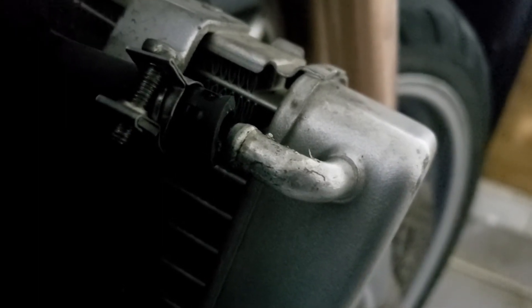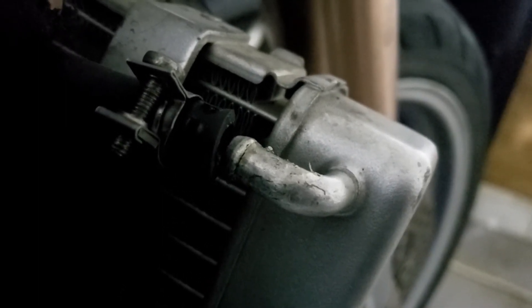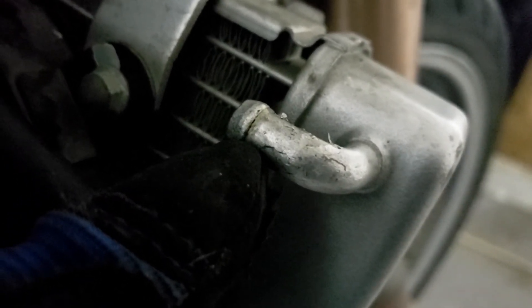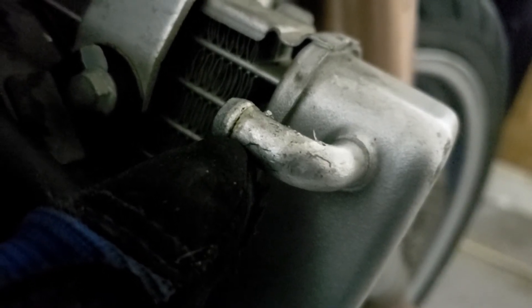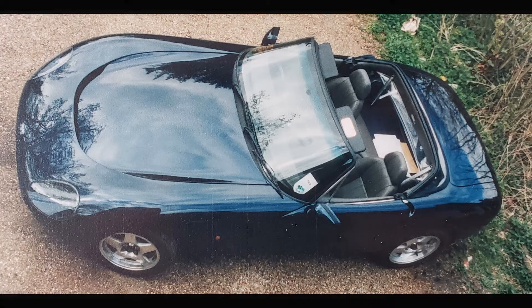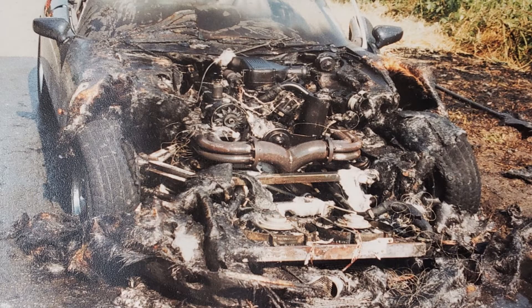You get an even distribution of tightness with those clips — they're not cheap, but nothing good is. The whole key to these hose clips being any function at all is actually that little lip on the pipe that they clamp over. There's an amusing story about that with a TVR Griffith — a wonderful car, one of my all-time favourites. TVR in their wisdom had the main fuel line with a Jubilee clip and no lip on the receiving metal end, so one day it popped off and the car caught fire.